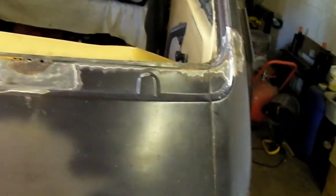Got the grills out. That little inner grille here was only four tiny little screws, and then you just had to lever off slightly because there were little clips built into the plastic grille. That headlight's out. I've left this one in just to show how easy it is - just four screws, little cross-head screws. They pop out and then you unplug the back. I'm planning to cut down just inside that seam, drill out all the spot welds I can. Some around here - spot welds that don't exist anymore so I'm just going to have to cut along here with the grinder. And hopefully drill out all the spot welds along the bottom.